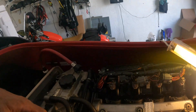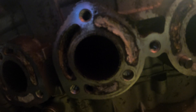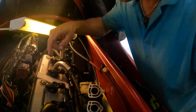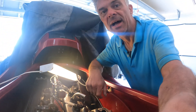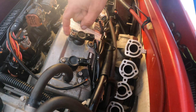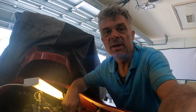Now it's fixed. You can see the cooling holes where the clogged one was. It's just a matter of putting everything back together, getting the gasket back on, tightening it up to specifications. Cylinder number three - actually number two - didn't have enough cooling and water flow. If I'm not mistaken, the problem should be solved now. Let's assemble the rest.